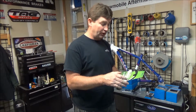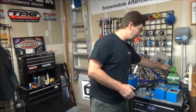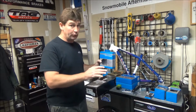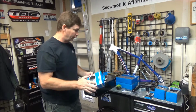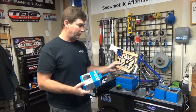So basically at my suggestion, he went with this one here. It's a 36 tooth. I know these hold the chain real nicely. It's a single ring up front. 10-speed rear. Got the SLX cassette with the kit. The kit itself too is $227 with everything but the crankset as far as the drivetrain goes. Everything. Gonna replace the 34 tooth with a 42 E13 extended range.